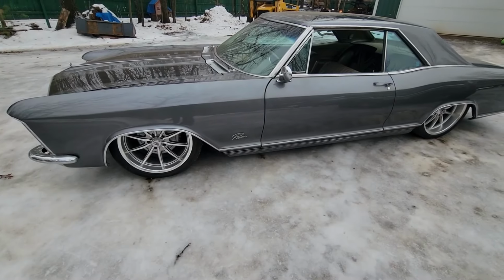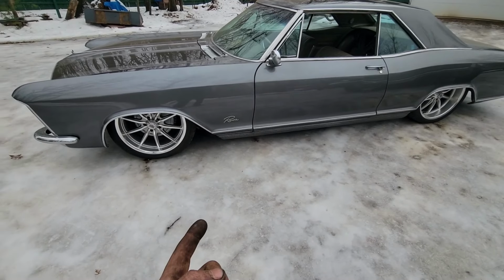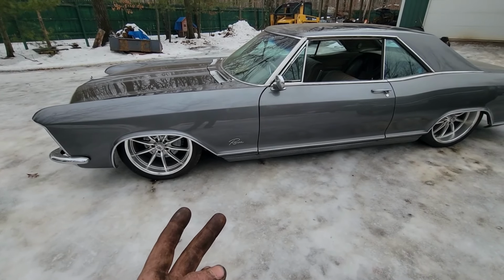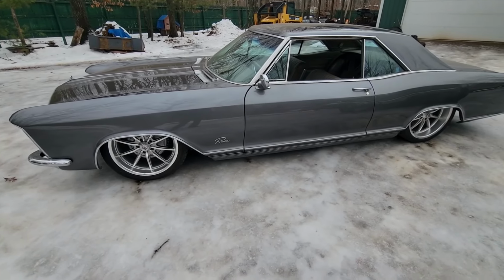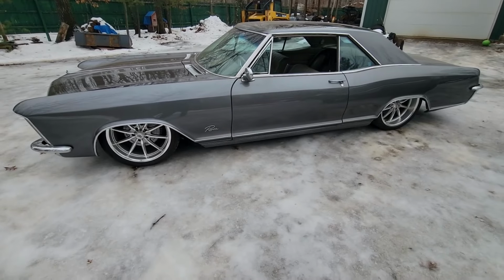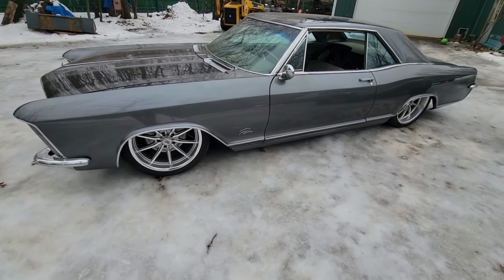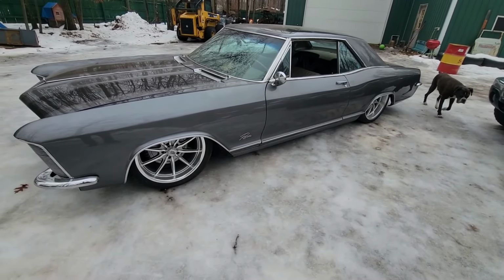I don't know when Tim will have those tailpipes done, because we got to wait till, number one, they run that material. Number two, on that die set, I think that's a 3-inch radius die. So they kind of have to be tooled up and running that material in order for them to bend it. They're not going to set the bender up special for me. But we can wait. We got a little bit of time for this white stuff to melt. But we're getting close on this thing.